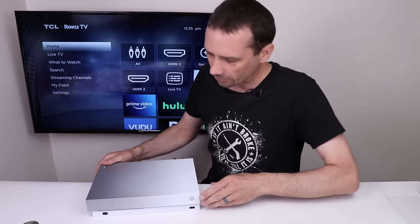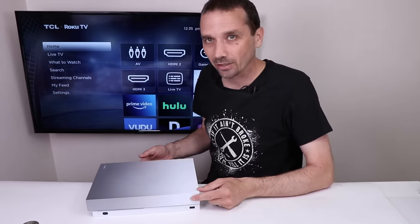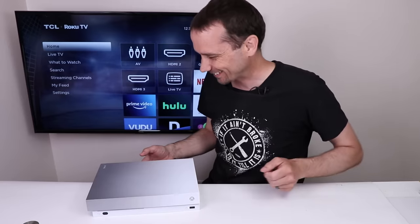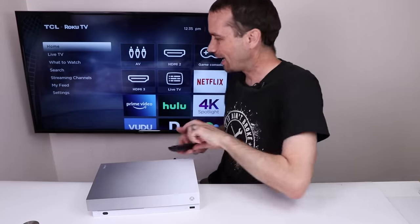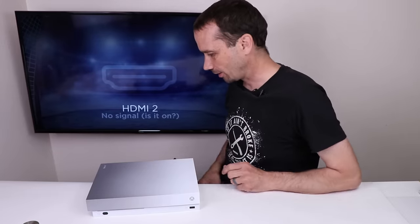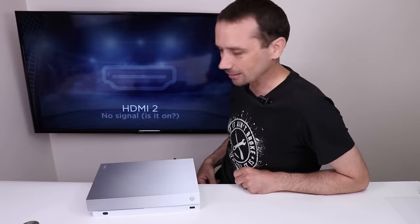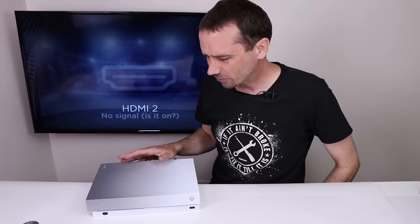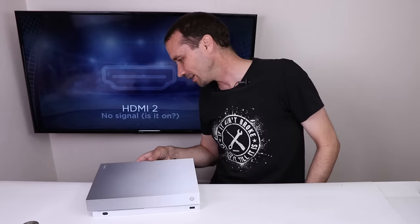Let's see what it does when we try to turn it on. Let's hear that Taco Bell sound. There we go. That's awesome. So it does have power. That sounds like an overheating issue to me. The fan ramps up right away really fast, and it does shut down. That definitely seemed like more than 7 seconds to me.